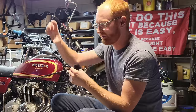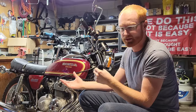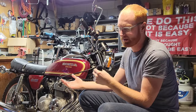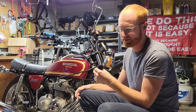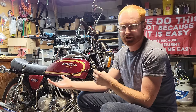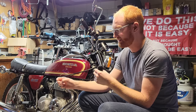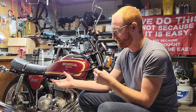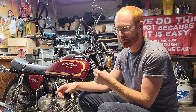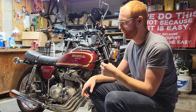However, I don't know if they were in the stock position, and I'm also using an aftermarket pilot jet. I had bad luck with the needle and seat from that aftermarket kit, so I bit the bullet and spent the extra money on some OEM Keihin jets. I'm going to pull that and see if it makes a difference, hopefully just getting that off-idle stumble out of the way.